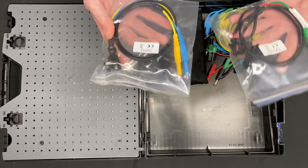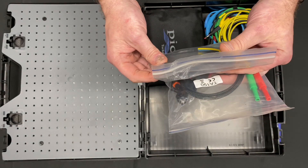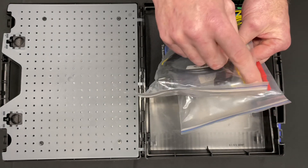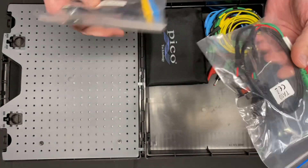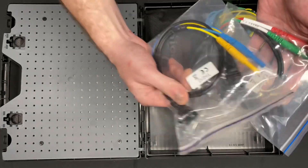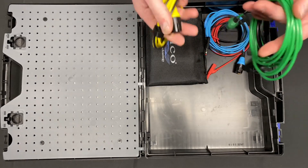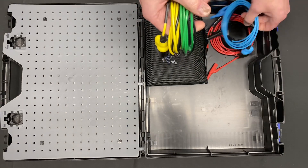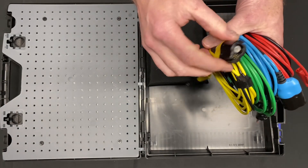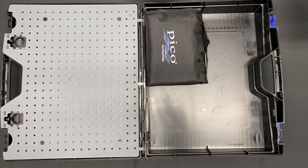Also included in the advanced kit are a couple of very common breakout leads. This one looks like a Bosch injector connector — you loop it into that circuit and carry out all your testing without having to back probe. There's another very common one as well. These are the TA190 and TA012 — the really common leads you'll use for cam and crank correlations and battery tests. These are what we call the times-one leads, all smart BNC, really good quality. You will use these a lot.